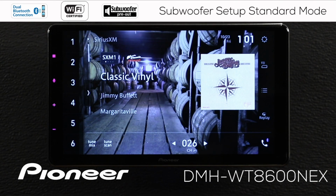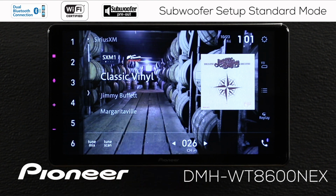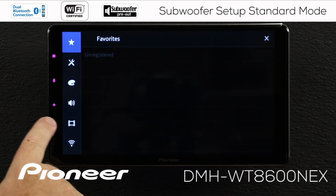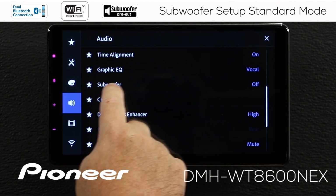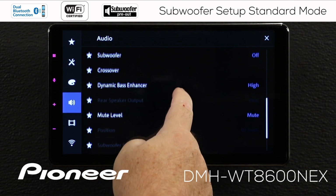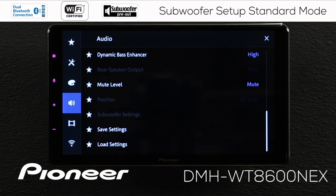So let's set up the subwoofer output on this receiver, and you can see I'm on the Sirius XM source right now, but this could be any music source, it doesn't matter which one. And I'll choose the gears up here, and under the gears, let's come down to the speaker, and that's our sound settings. So under the speaker, let's scroll along here until we find subwoofer, but you can see subwoofer is switched off, and if we go down here a little further, we can see the subwoofer settings are grayed out, we can't get to them.